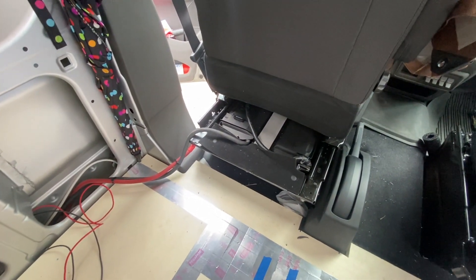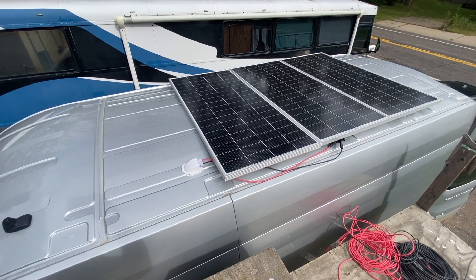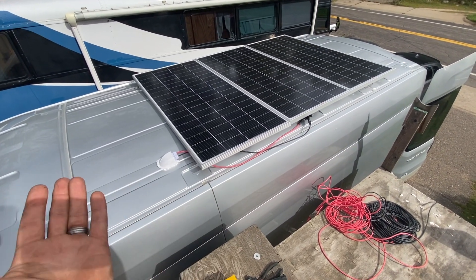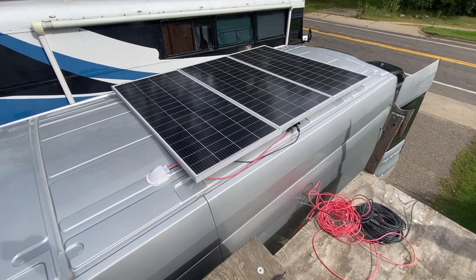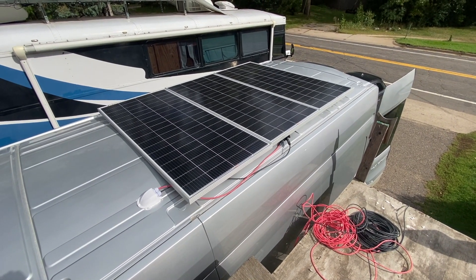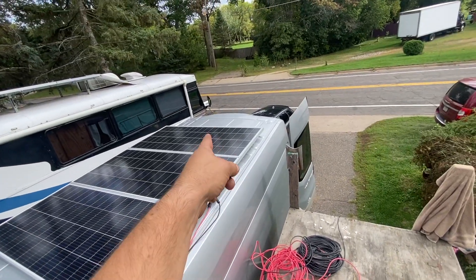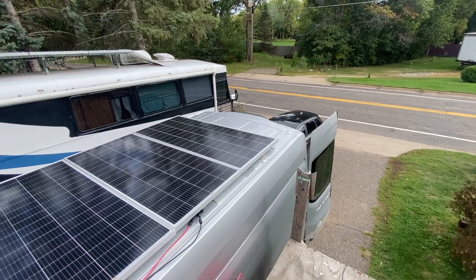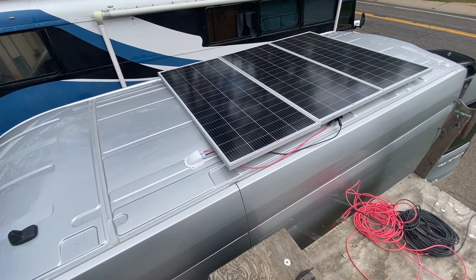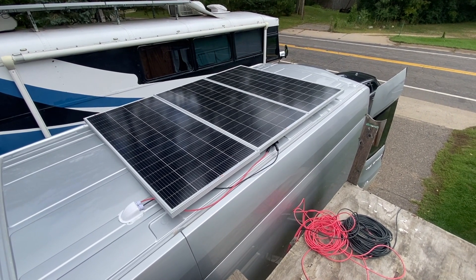What they're doing in these Ford Transits, I really like that. Up top here the panels we put together for position only — basically with the idea that they're going to add a roof rack later. The reason they're not permanently mounted is shipping problems. We're just testing these — they're 200-watt Rich Solar panels and they work really well. We're leaving room up front for a DC air conditioner, and a vent fan in the back. So you've got 600 watts of solar up here and I think that's going to work out great.